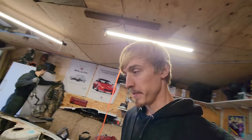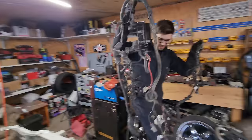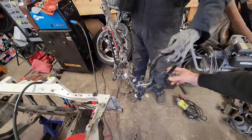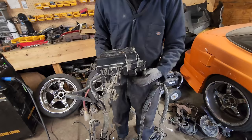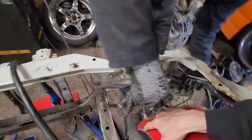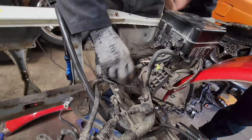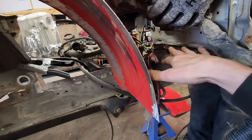We did tack one tub into position — we only have two little tacks here — because we don't want to proceed any further until we confirm the fuse box still fits. That's your whole engine bay harness? Yep. And some of the interior too. Technically, this fuse box is massive. That's not gonna fit. Let's see if you can bring it up from the bottom. You could probably make it work, but then we gotta think about the intercooler pipe — I guess it could fit right there still. It's gonna have to get modified anyway for the intake. I could just trim off this whole bottom section and move the connectors up too, so then it could hang down further.